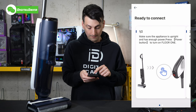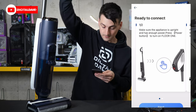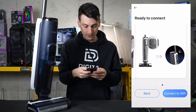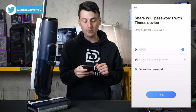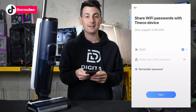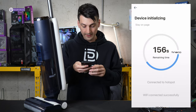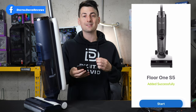The first step is to power on your device, and the second step is to press the Wi-Fi reset button. So let's go ahead and power it on. Now we can select next. We need to press the Wi-Fi button for three seconds on the back — holding it down. Now it says connecting — let's choose connect to Wi-Fi. At this screen, we're going to need to connect to our local Wi-Fi network. Please make sure it's a 2.4 gigahertz Wi-Fi network; this will not work with a 5 gigahertz network. Choose your network, enter your password, and select next. Now we need to scan the barcode on the back of our device. We got a prompt to join our Wi-Fi network — select join — and it's going to finish setup. It just successfully set everything up, gave us a voice prompt too. That took less than 15 seconds — super impressive.